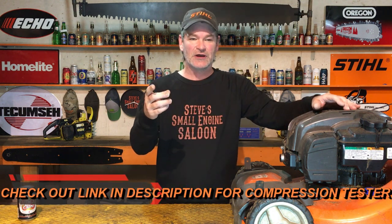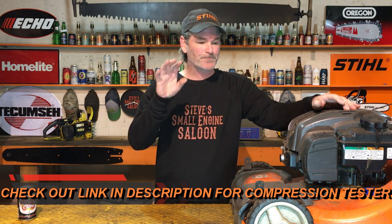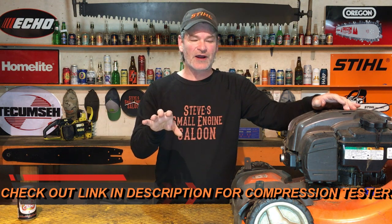An internal combustion engine, like is on your lawnmower, needs three things to run. It needs an adequate fuel supply, it needs adequate spark, and it needs adequate compression. For you technical guys out there, I do have a link in the description of this video to take you back to, so you can see the compression tester if you want to do that.